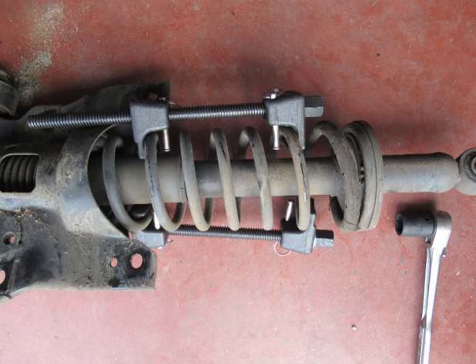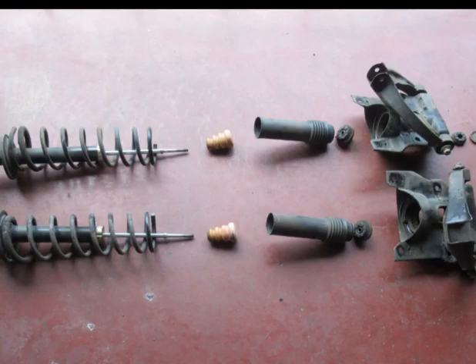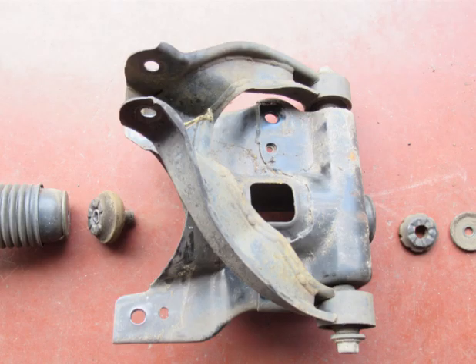This spring compressor tool has little retaining pins that move out to hold the coil — make sure they are extended. This tool works better if it's installed in the opposite direction. The nut on top also has a provision for half-inch drive. Here are the rear struts completely broken down — you can see the spring is tapered and will only go one way. Be sure to install the dust boots — the two yellow ones and the two black ones — before you install the strut into the spring. The washer at the far right under the nut goes a certain way, so be sure to put it back correctly. Lubricate the bushings with WD-40 or silicone grease.